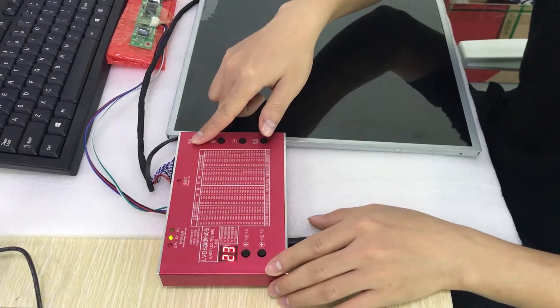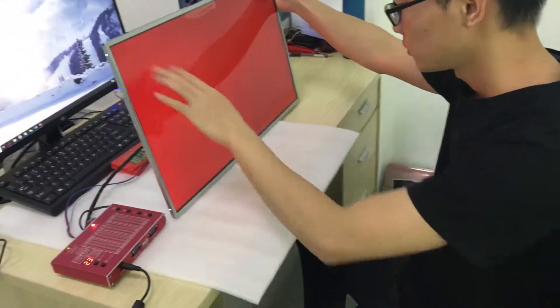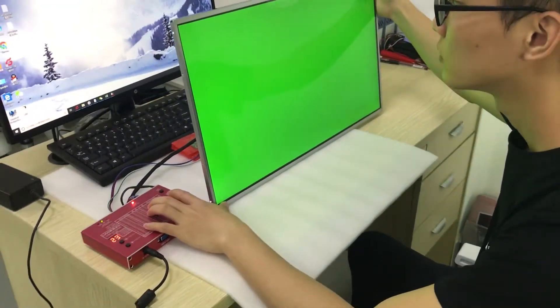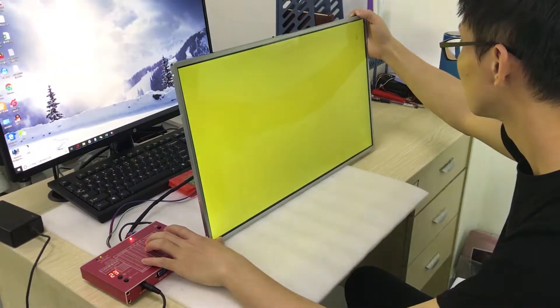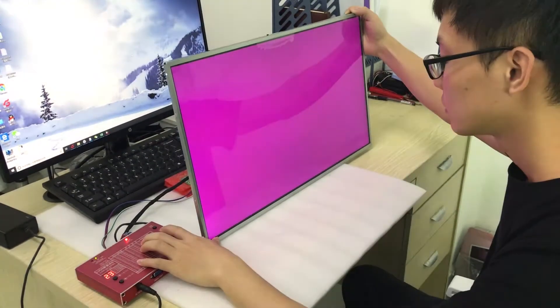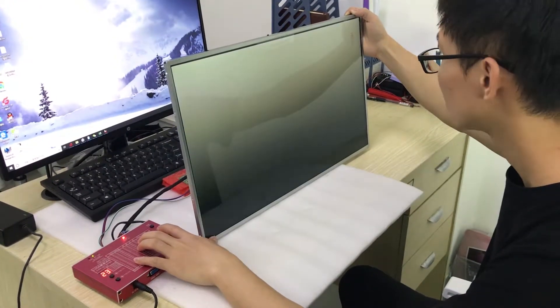Then, we are going to check for broken pixels or other deviations in the operation of the LCD panel. The manual test mode allows you to gradually check the new matrix for broken or burned pixels, make sure there are no highlights or colour spots, assess the uniformity of the backlight, and make sure that the colour is correct.